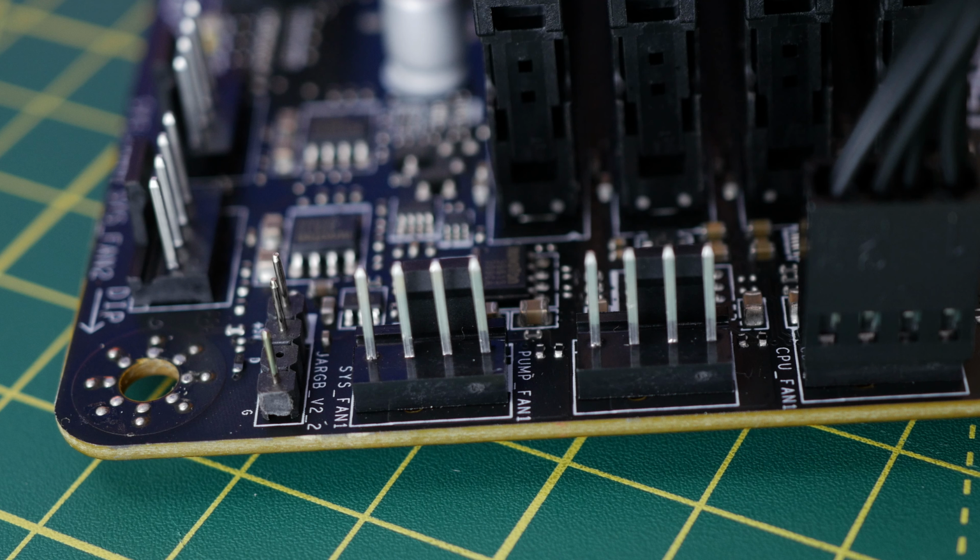The other connector is the SATA power connector, which is the same one which powers SSDs and hard disk drives. That comes from your power supply unit, and that connects up to the RGB controller as well. And obviously you'll need multiple cables for multiple controllers, so it's worth bearing that in mind as well. So you can see how complicated this is if you have, let's say, 10 fans in your case. So the easiest solution for NZXT fans is instead to get NZXT's fan controller.